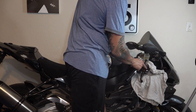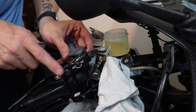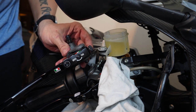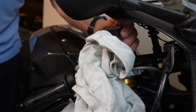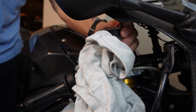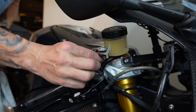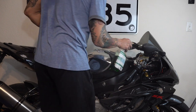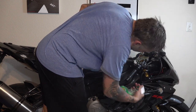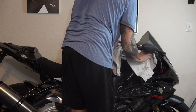The only other thing I need to do is see if my previous lever will go in there. This is a Brembo lever and that's fine, but I'd already spent the money to get these TWM low drag levers, which is important for the Texas mile. Put your cap back on the reservoir. Once you have the fluid up to a decent level, don't forget your gasket under the lid. Don't forget to put your rubber cap back on the bleeder valve. Get rid of that blue tape, and then spray everything down with some Simple Green to get all the brake fluid off that you may have inadvertently got on the bike.